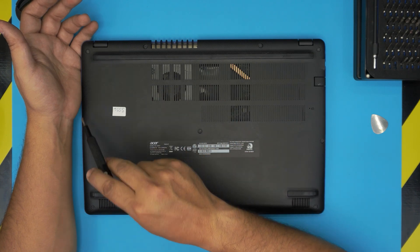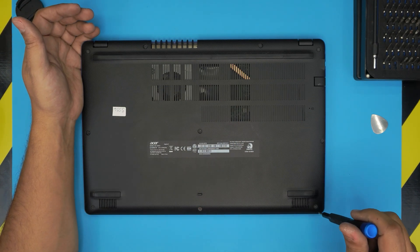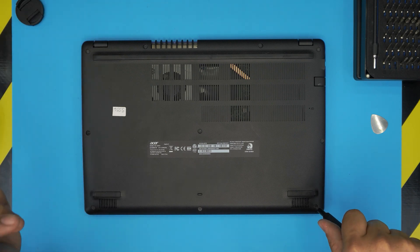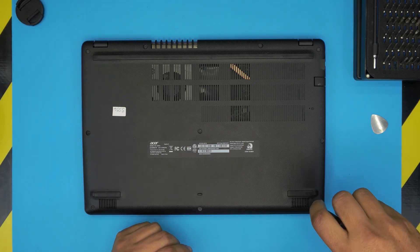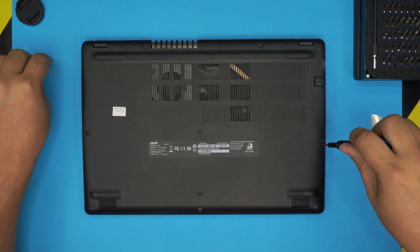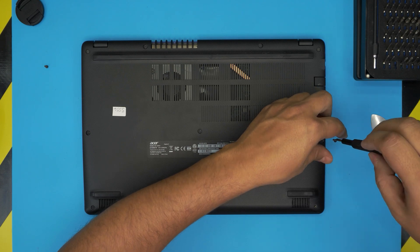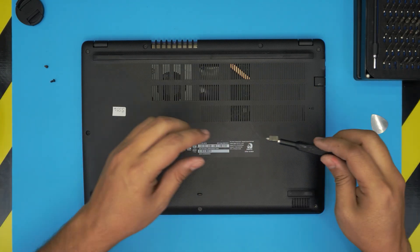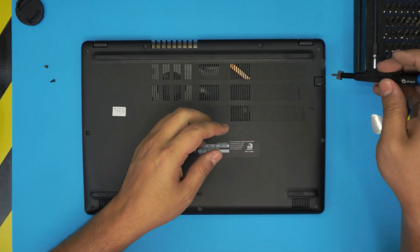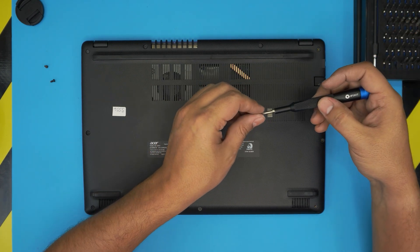What we want to do is remove all the screws on the bottom of the laptop, including the one in the middle — people usually forget that one. All the screws are the same size and height, so you can't mismatch them; put them in one pile. I put a little magnet beside my screwdriver to make it easier to lift up the screws.